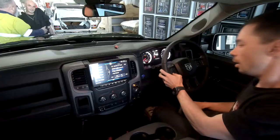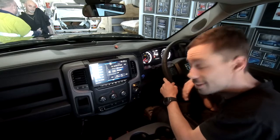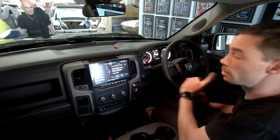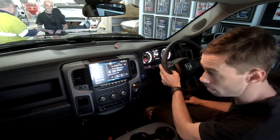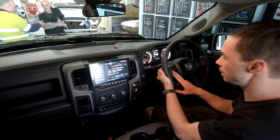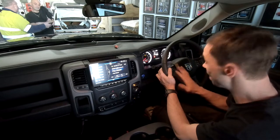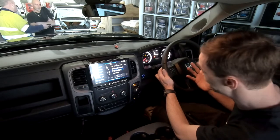Alright. Oh, there's another thing. These ones don't actually come with steering controls from factory. No steering controls for the radio whatsoever. So the bonus with the pack harness is that I'm able to manually program two of the buttons here that are actually designed for the MFD. I can program them to run the radio. When you're on the speeder, it doesn't matter. They're not in the same position or used, so it doesn't matter.